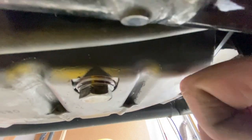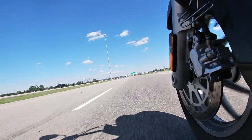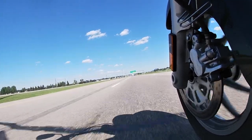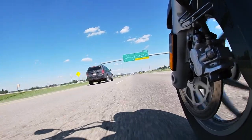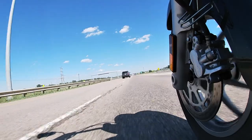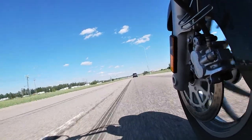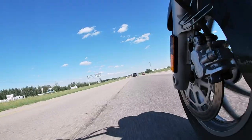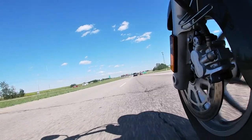Here's your oil drain plug. Remove the oil dipstick, which is on the left hand side just above your shifter - it's black and round so you'll find it. By removing this we are eliminating any sort of air lock that will be created by our next step. With a pan or jug underneath the oil plug, it's time to open that baby up. Be sure to not let the oil plug fall into the oil because that's just messy. There should be a washer on that plug as well - save that. While the oil is draining, remove the filter; there will be oil in that as well, so have something underneath to catch it.